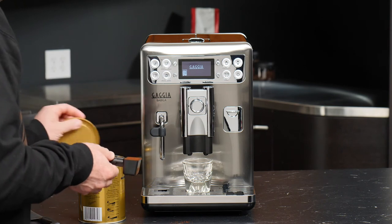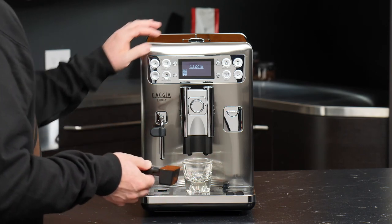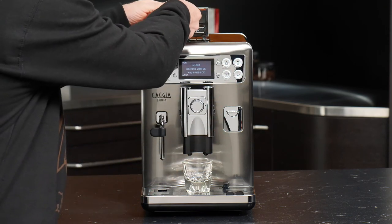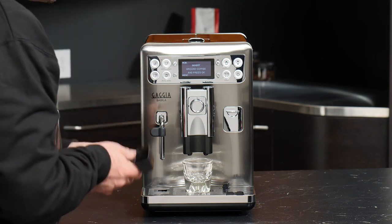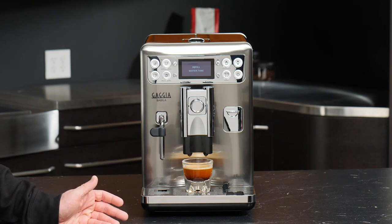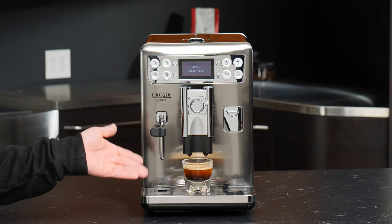This is a terrific option if you have guests who prefer decaf but have caffeinated whole beans in the hopper. We'll press the aroma strength selector again to get our scoop icon, press espresso, and we're prompted to insert our coffee into the bypass chute. Simply tip it in gently, close that up, and brew. As you can see, with proper technique, restricted flow, and some great pre-infusion, we have a delicious looking shot of espresso prepared using pre-ground coffee.